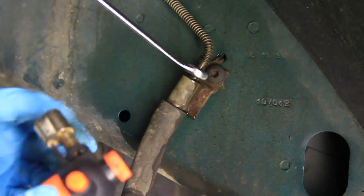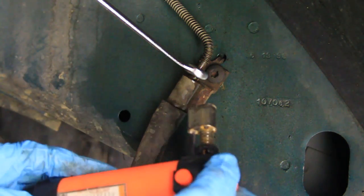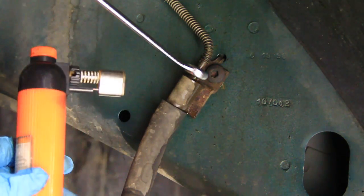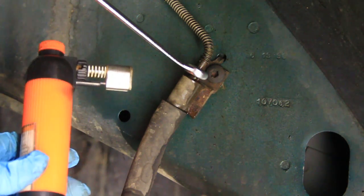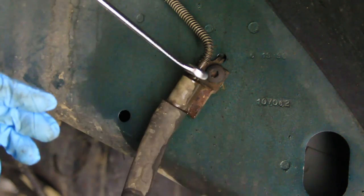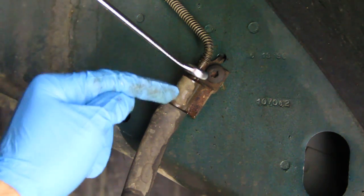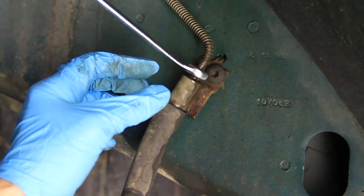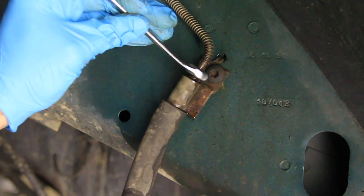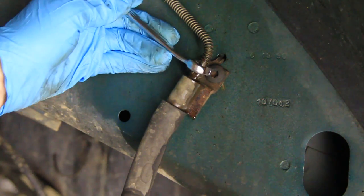Even these line wrenches can round it over. I bought one of these at Harbor Freight a while back — it's just a little mini torch, and this thing comes in really handy. If you haven't learned from my videos by now, heat does wonders for breaking bolts loose, and it's probably not good for your brake fluid, but all that's going to spill out anyway. What I did was I heated, with the little torch, the bottom part. The part that you heat is going to expand, so if this part expands, it's like the fitting is getting smaller. Once I heated it up, it broke free very easily. I could tell it was going to round over because I don't think it's ever been off.